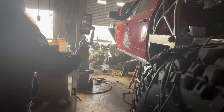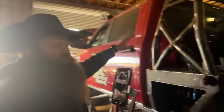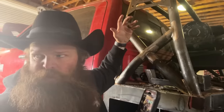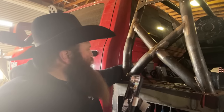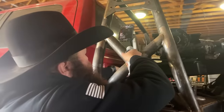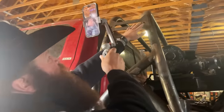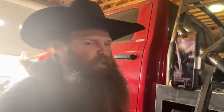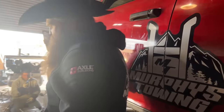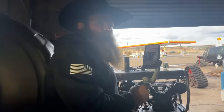Do we have side winches on Hellboy? I don't think you do yet, right? Right. So the side winch, we're not running side winches, plural. We run a side winch, same thing as we run on our black mega cab on track. I mount a winch in the body right here, and I run a fairlead up, and I could run it off of both sides. My fairlead's right here. I can show you the setup. So we run one winch to cut down on weight. There's no reason to run multiple winches. You're not going to be winching off each side at the same time.